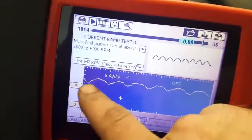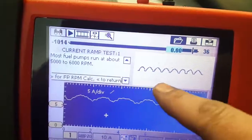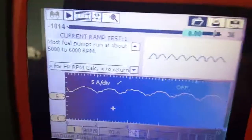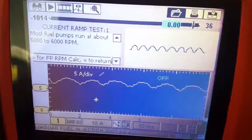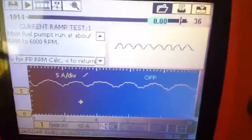This is what my current waveform looks like — you can see how it's kind of rigid and uneven. This is what the known good waveform is supposed to look like: nice even peaks across everything. What you can tell from this is the commutators are actually wearing out, drawing too much current, and as they're overheating they're starting to shut themselves off.